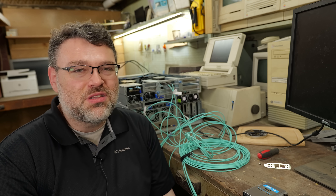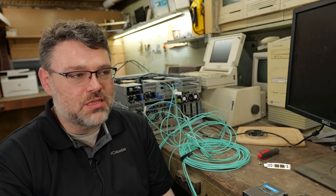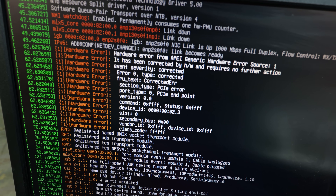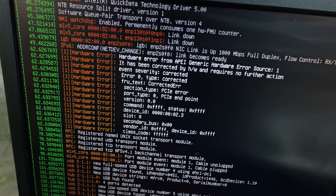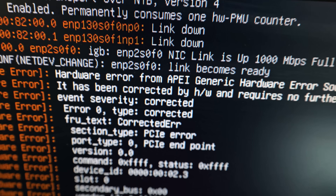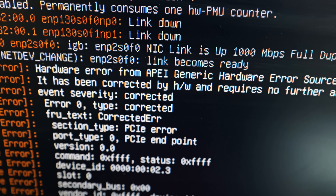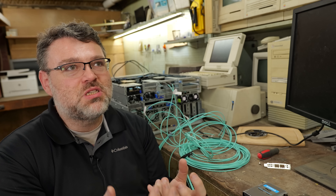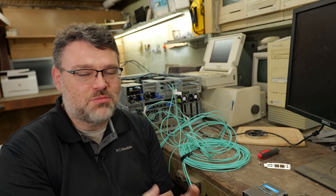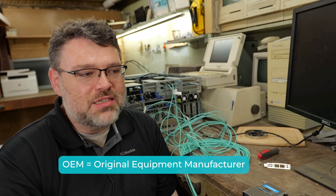A lot of things like Cisco UCS servers will complain a little bit, but it works anyway. I'm very happy that it works this way, because there are people in the Level 1 community hanging on to slightly newer UCS servers and slightly newer Dell and HP Enterprise servers — and some of them merely complain but still work, as opposed to being locked down. There are some SAN appliances that want a specific flash drive, and even if you have that drive, unless it has the OEM's firmware on it, it will not work. And that is annoying.